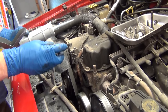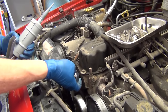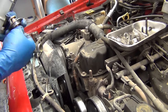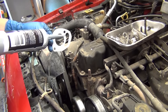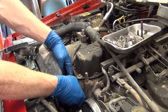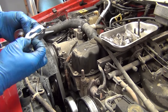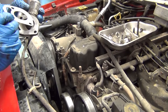The next thing is to put the thermostat in. This is the highest point — air goes to the top of the fluid and we want the air to go through. You'll notice there's a little indentation; as I slide this down it'll click in. We want to glue it in there without blocking our hole. Then we put the gasket on — the little round hook part should go up and the bolt should match. The ideal way is to have the sticky side face the engine block side, not the thermostat housing side.